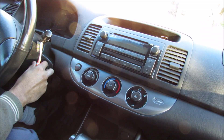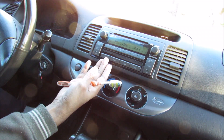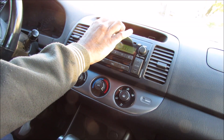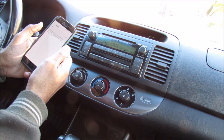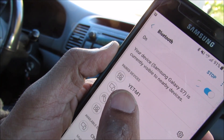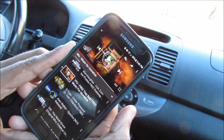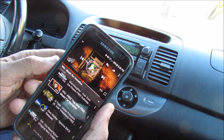Now here comes the moment of truth. I'll turn the ignition key to the on position, and when I turn on the radio the AM, FM, and CD should work as normal. Because we've wired the auxiliary input to the CD lines, we need to trick the radio into going to CD mode to read our Bluetooth input. I'm inserting a CD with just a blank track, which will overlay on top of the Bluetooth signal. Then I'll go to my phone, turn on Bluetooth, select YETM1 — the name of my Bluetooth module — and connect. Now I can open any music app on my phone and press play. I'll be able to use the volume and equalizer buttons just as I would for a CD, and this gives CD-quality sound.